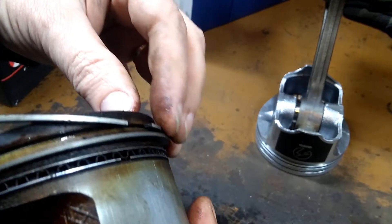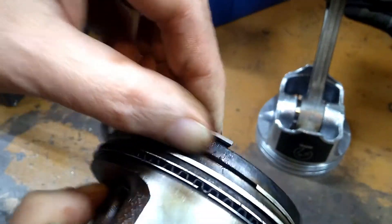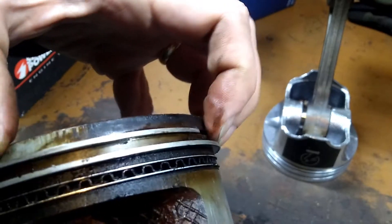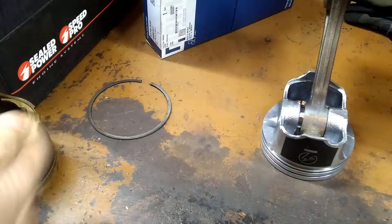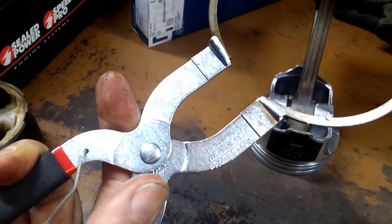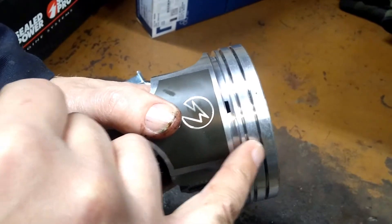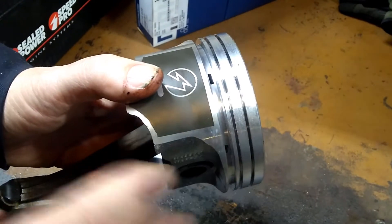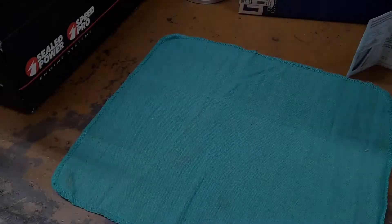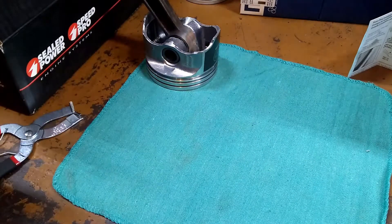You can put the rings back in by getting the edge in there and then wrapping it around — it goes in fairly easy. Honestly, if you're just rebuilding one engine, that's probably good enough. But if you've got access to them, a set of ring pliers like this are really handy, because you can just put the ring in here, grab onto it, it spreads it out, and you can just put it right over the top. When we're putting rings onto these, we want to start at the bottom and move up, because if you start at the top, you end up having to pass over the rings you already put in to get to the lower ones. So we're going to install from the bottom ring toward the top. Before I start assembling, I like to have a nice clean surface and make sure that nothing gets into these grooves.